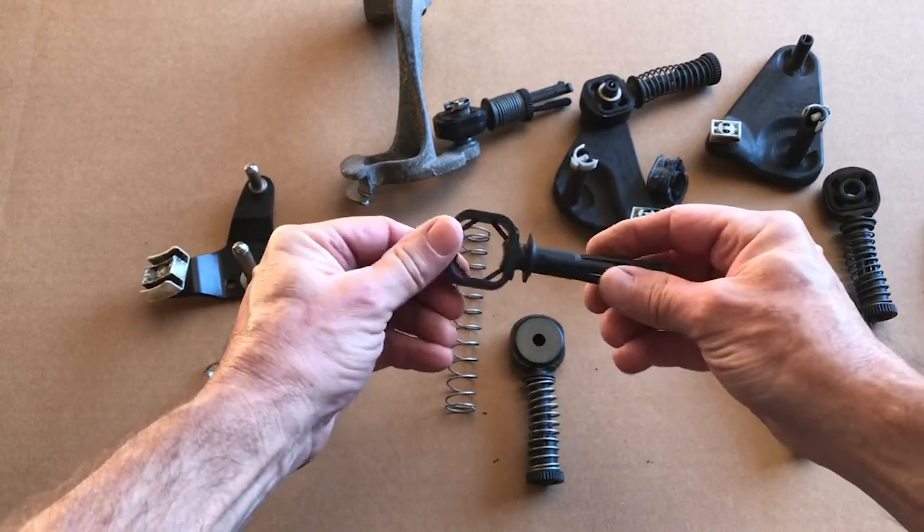To perform the alignment, locate this plastic L-lever here. Push in a little bit and it'll stop, then push down — when it reaches the home position, that pin will drop in a little bit farther and turn up. When it's in the happy spot, the selector shaft won't really want to rotate and won't really move up and down. You push in on the pin while feeling with it and pushing down on the selector shaft, and when it all lines up, the pin will drop in further and turn up.